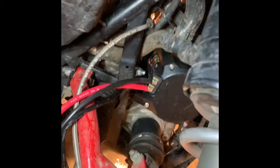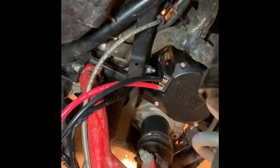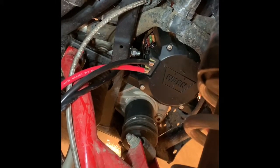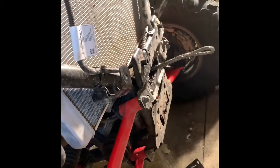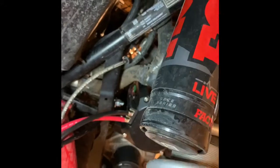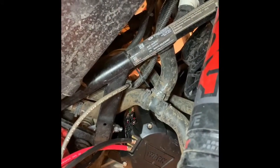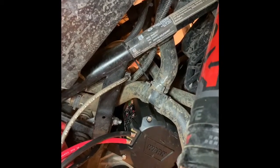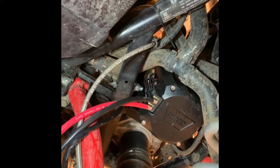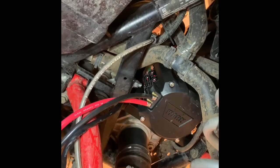This was not fun, but after you get that plate mounted I recommend putting the positive and negative wires on before you install the winch. Also pull the fairlead rope through before mounting the winch, because it's really hard to get your hands back there. As you can see in the Dynamics here, there are tubes everywhere — the turbo causes all those radiator tubes — so it's a tight squeeze. Next you'll mount the winch to the plate with the four provided bolts from WARN. Now I'll start the wiring.